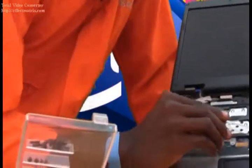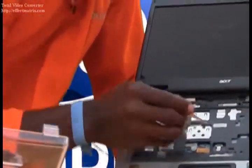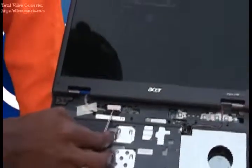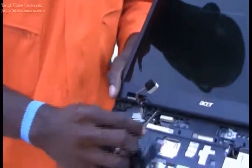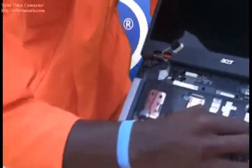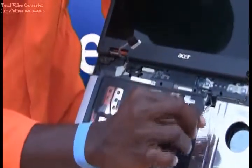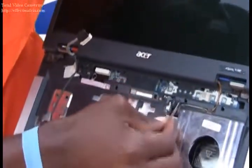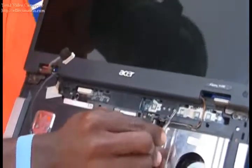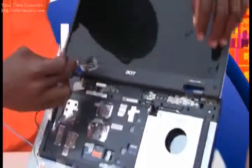The next will actually be for us to disconnect the flex cable for the touchpad. So we pull this out gradually, extremely gradually — disconnect it. Then followed by disconnecting the VGA cable. Take it off easy. Then we disconnect this very wide flex cable — we pry it out. And then next followed by disconnecting the webcam. The webcam connector — we have to disconnect it out, take it out gradually.